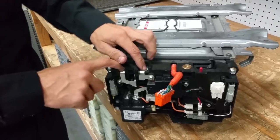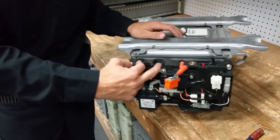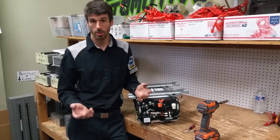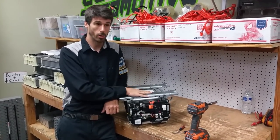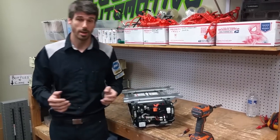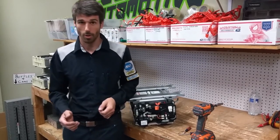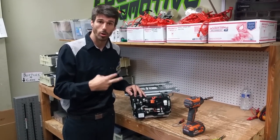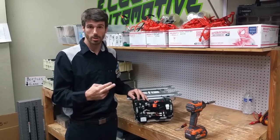Even though this is totally safe whether it's on or off, what you need to be worried about are the two wires in the vehicle. The electric motor under the hood is also a generator, so it creates electricity. If your engine is running while those two wires are out, there's high voltage. The Honda will still start and run even without the hybrid battery, but the engine spinning means that electric motor is creating electricity and those two wires in the car are going to be high voltage. The car needs to be off for five minutes before you go in there and let those two wires drain down their voltage.